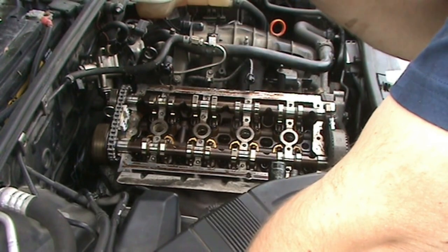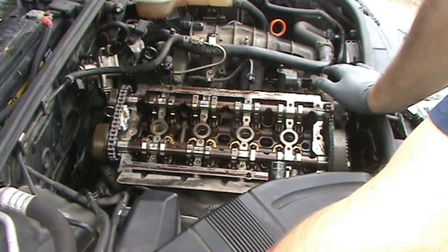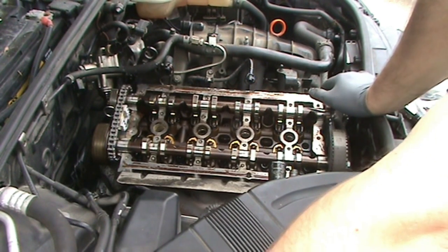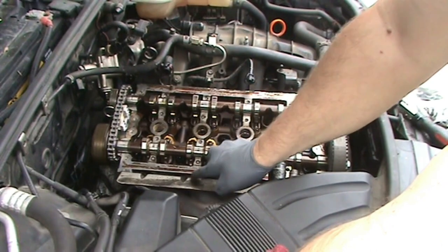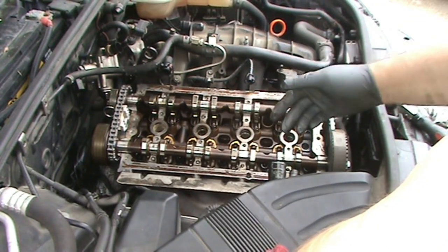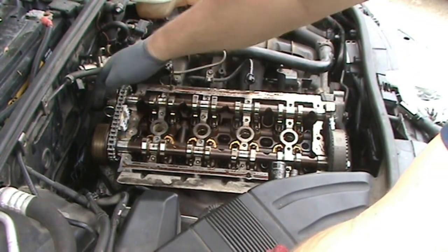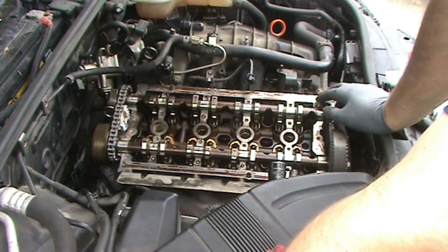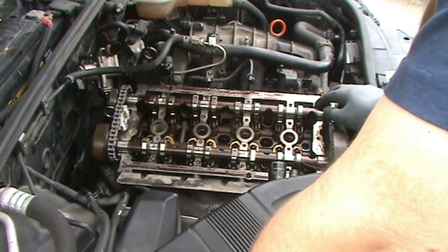And whatever this stuff is that Audi uses, the oil just eats right through it, and eventually you get a huge leak, and then there's oil dripping out of this thing. Like I use a quart of oil every oil change. Like in between oil changes, I have to put in an entire quart of oil, sometimes two. And that's just excessive, and you can see, well, maybe you can't see, but here, that's all oil that leaked out of the seal. And the seal between that and the seal on the valve cover as well. Both of those leak. And it was leaking here and back here where you have the housing that houses this gear and chain. So if that's what to expect out of that material, I'm fine with using RTV. It might be an improvement.